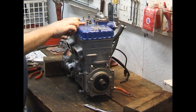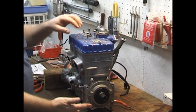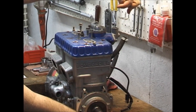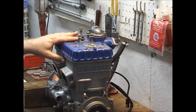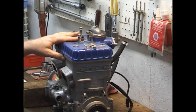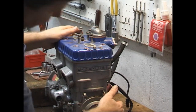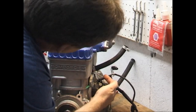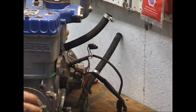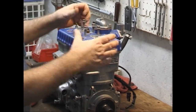This bracket over here — the bracket that stood up so tall here — was the top bracket for these radiators that mount to each side back here. This bracket here was the oil injection tank; the tank was removed, but that was the metal bracket the tank attached to. It has to be above your inlet for the oil injector pump. There are several different ways you can mount it; that was the most appropriate.